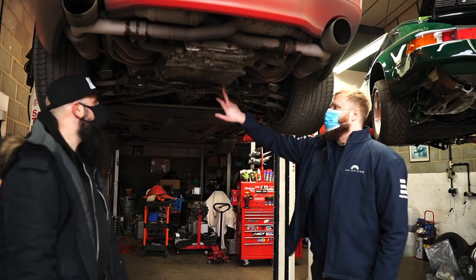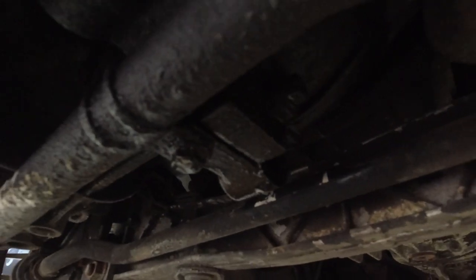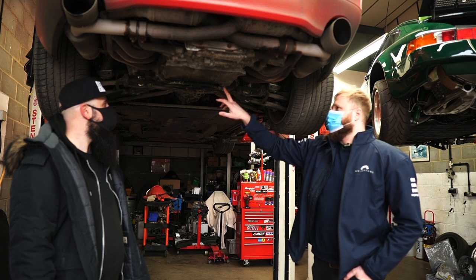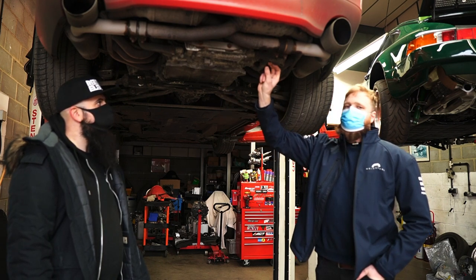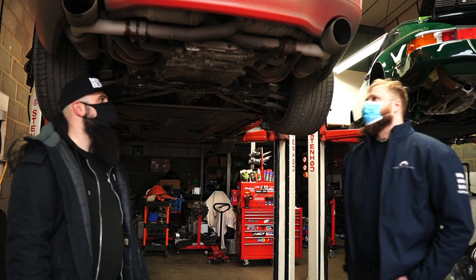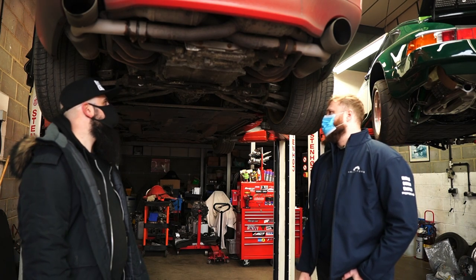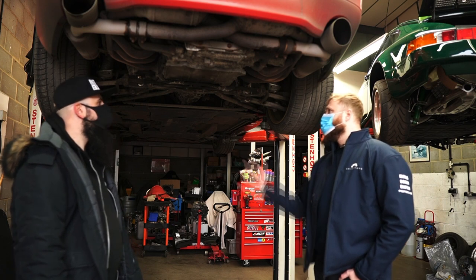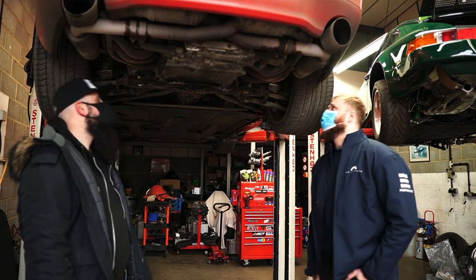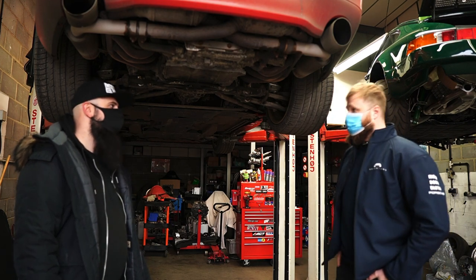Just quickly, we've got clips here that are holding your rubber coolant hoses on. They don't give too much trouble usually, but yours are a little bit corroded. I wouldn't be overly concerned, but this winter if you're driving the car, the salt on the road could make them lose their grip and then you've got a coolant leak. It's worth checking them over, but most of the time they're okay. I'd suggest maybe checking your brake pipes if they are corroded, but your MOT and regular servicing should pick that up, so I wouldn't be majorly concerned.